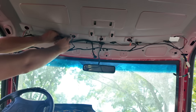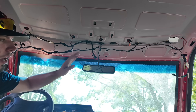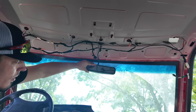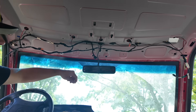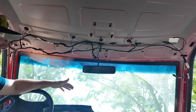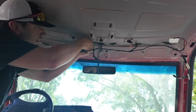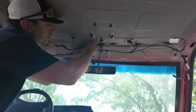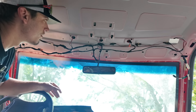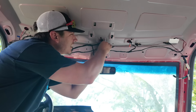The reason why I'm taking all of this wiring is because what was already in this truck had the compass, miles per gallon, and temperature on the screen, and it also has the electric auto-dimming rearview mirror. That other truck didn't come with any overhead console, so that's why I have to pull out this wiring. I'm hoping that, since everything on these trucks is pretty much plug-and-play, when I plug it in at the fuse panel it should hopefully just plug and play and work.